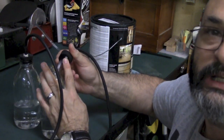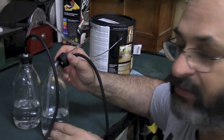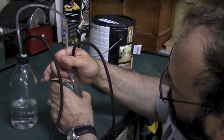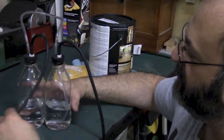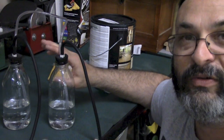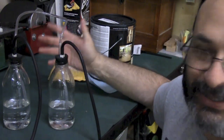I'm going to pull one of the stoppers out here, and you can see it only goes to the other side of the stopper — it doesn't go down into the bottle, and that's the case with both bottles. Then there is another clear tube that goes all the way down to the bottom of each bottle. After you set that up, go ahead and close these up really well because there's going to be a suction of vacuum created. If one bottle gets more vacuum than the other, it's going to suck the water up the tube and into the bottle that has less vacuum — the other one will have more pressure and push the water up into that bottle. That way you'll know your carburetors are unbalanced and creating more vacuum on one cylinder than the other. I don't know if it's technically correct the way I'm explaining it, but that's sort of how this works.